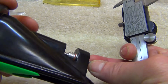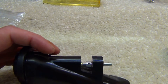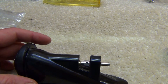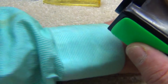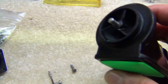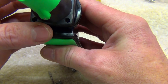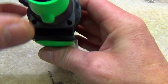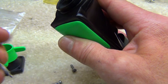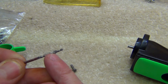There's a 4 millimetre prop shaft. Once the jet drive is fitted into the hull, you're going to have to drill four holes — you don't do that before, because things might not be square. You need to look at it at the end once everything's fitted, to get it as square to the job as possible. I use a 2 millimetre drill, and I always put a little bit of tape on it so I don't go too deep.